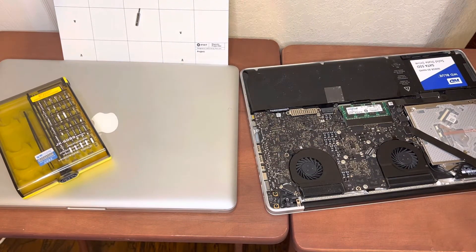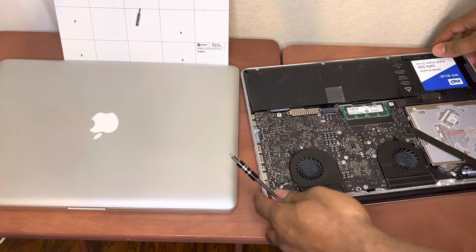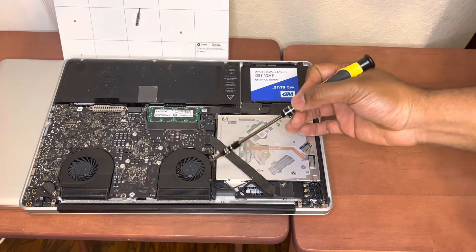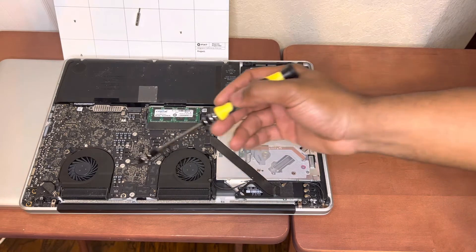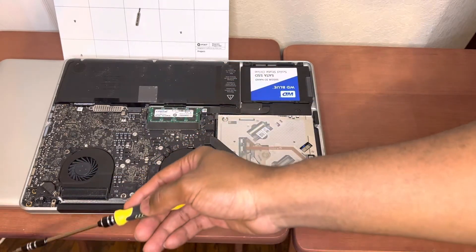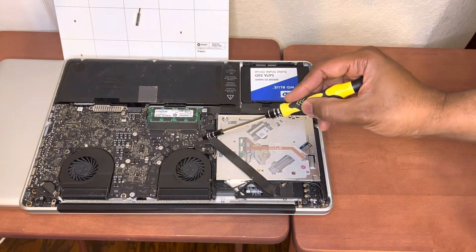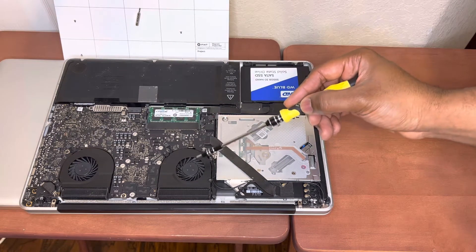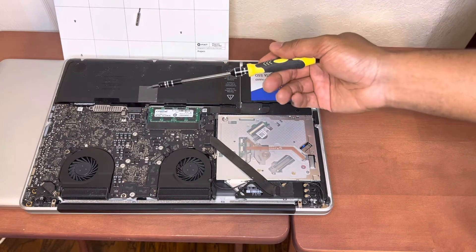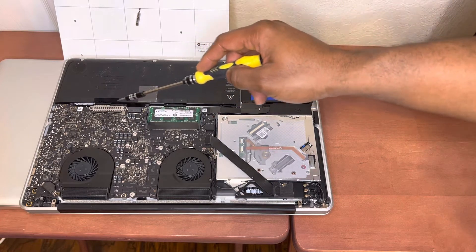There's a link with instructions in the video for how to get this done — that video isn't identical to this laptop, but it's short, fast, and to the point. From a high level, you're going to take off screw one, two, three, take the fan off, be careful with the plug. Peel it off — one, two, three — pull the plug out, pop this, pull this out. There's a little ribbon that feeds in here, pull that out as well. This comes out, this comes out — here's the power connector, so you want to pull this out first.